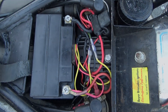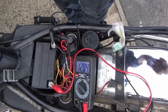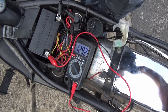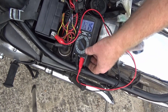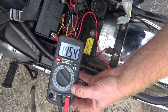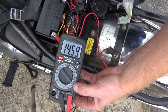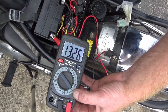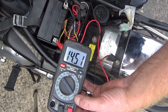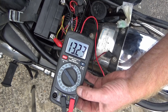Let's see if there are any sparks first - nothing, which is a good sign. A bit of tidying of those wires and let's see if we can get it to charge up. Come on, old girl. A few moments later - let's see the voltage over 3,000 RPM. I'll put the lights on and see if it matters. At tick over - yeah, happy with that, much better, much more stable.